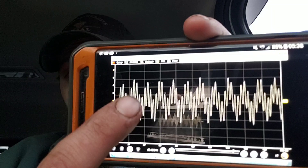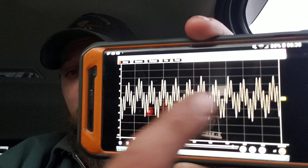What I overlooked, because I wasn't thinking, was a rather basic test. This was basically starting to look like a diode signal — or failing diodes — basically too much diode ripple in the alternator. Putting the vehicle under a heavy load in one direction or the other was causing garbage-in, garbage-out: a real noisy, spiked-out waveform going into the PCM power feed. And with that hitting the rest of the sensors, you're going to get some weird stuff happening.